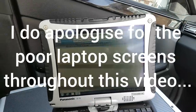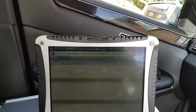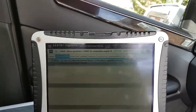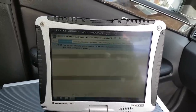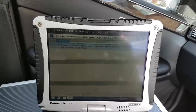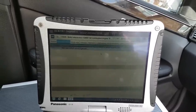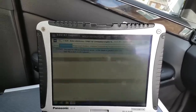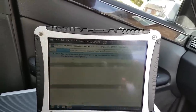I've saved you from all the login stuff and we are now on the ECU. The fault code is P2454 00, and it says the input for differential pressure sensor one in the diesel particulate filter has a short circuit to ground. So the ECU is telling me the sensor is short to ground. I'm going to start the engine and see if the sensor is actually working.